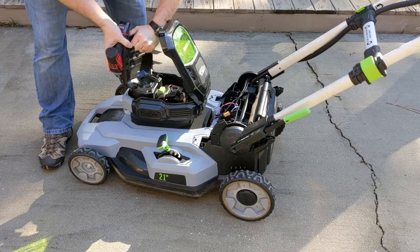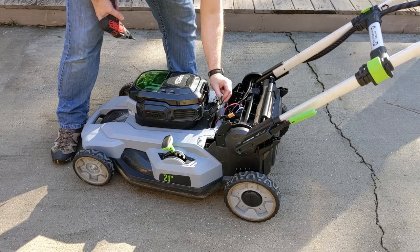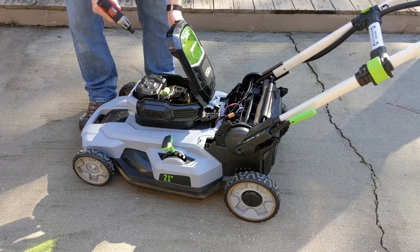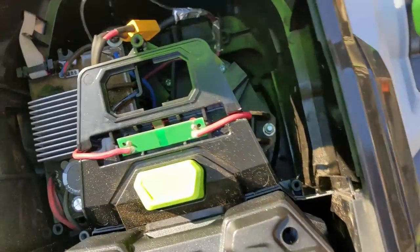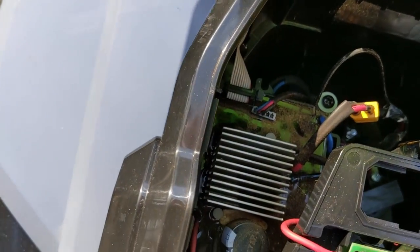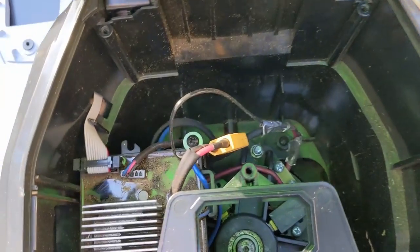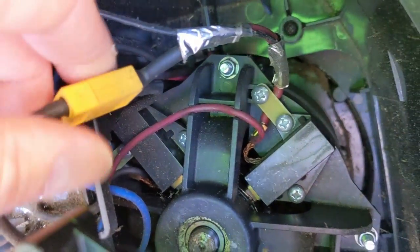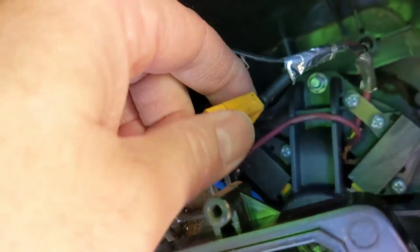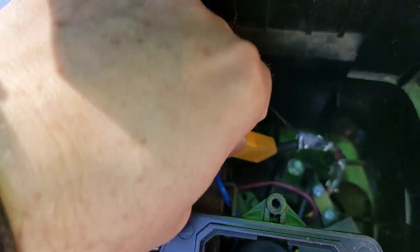We'll lift up this cover and take off this screw here as well. The light's not coming on either, but I don't think there's a problem with the actual push button. Now we can take a look inside — we do see our controller, and unfortunately the potting is hard potting, so there's probably not going to be any repair on that. We have our fuse, which is good, and our foil brushes on the motor look good. This EGO LM2100 has an XT60 connector, which I really love — that means I can try something useful for troubleshooting.